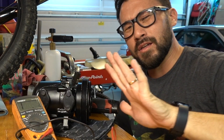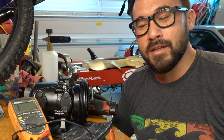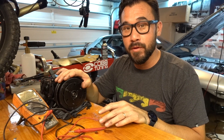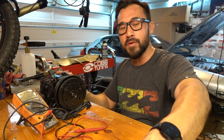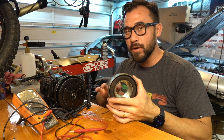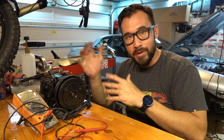It's pretty simple: no more than five ohms and no less than two - that's how you test a compressor clutch coil. If you want to replace the coil, leave the compressor on the car - it's going to save you a ton of money. The coils themselves range between 40 and under 100 bucks. Compressors themselves for a good name brand one, you're talking hundreds of dollars.